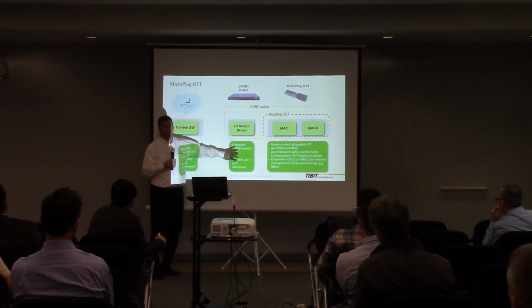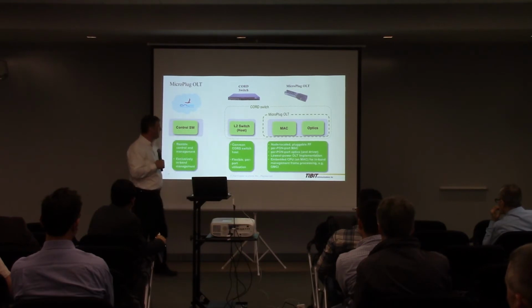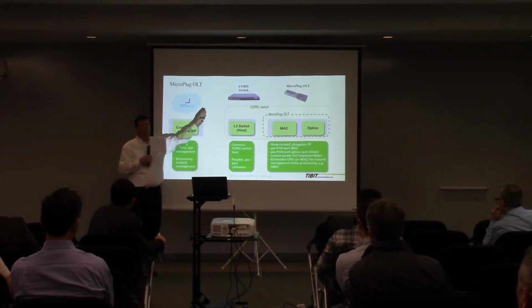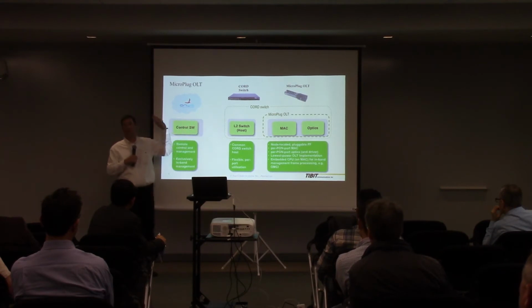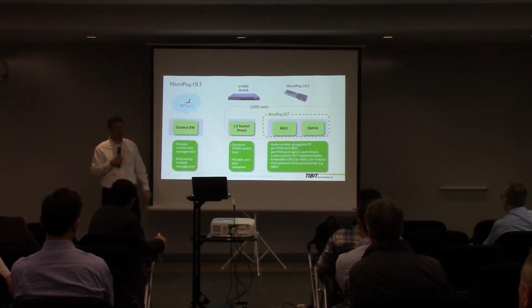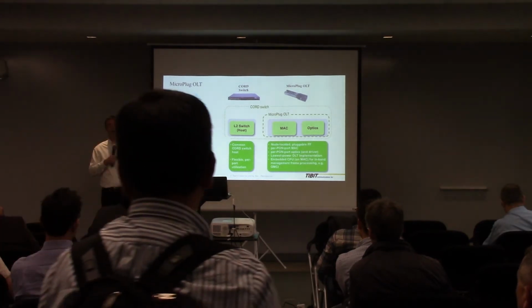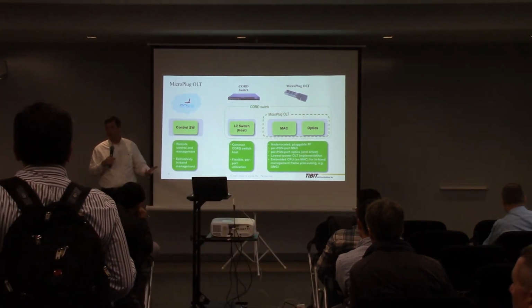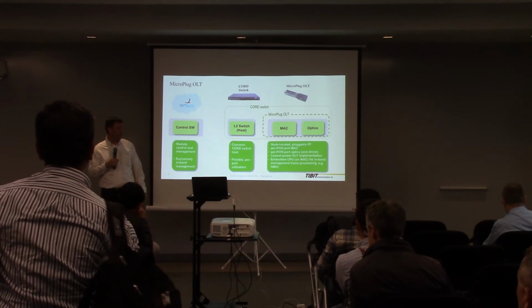And all of that lets us then sit on a common platform layer 2 switch host. It not only gives you the ability to then put management further up in the network, right? Could be local at the switch, could be at the rack. This could be 100 miles away at a network operating center. But it actually means this is the only way to manage this. This really forces remote management into the application, and again fits really well then in a CORD architecture.